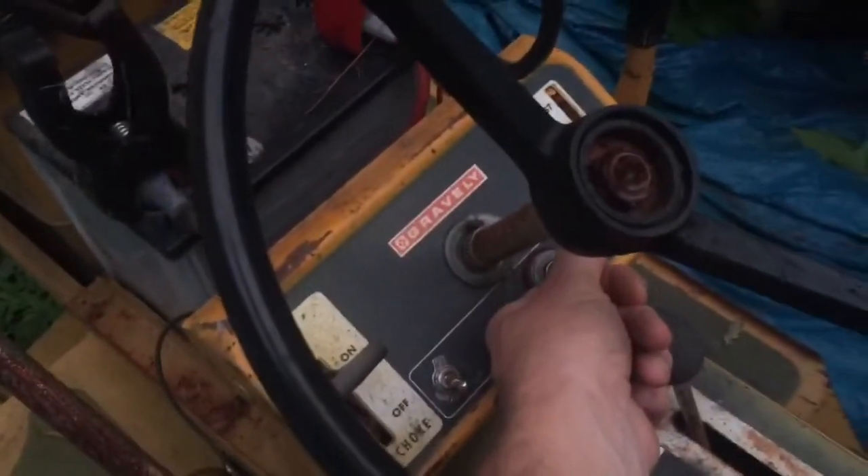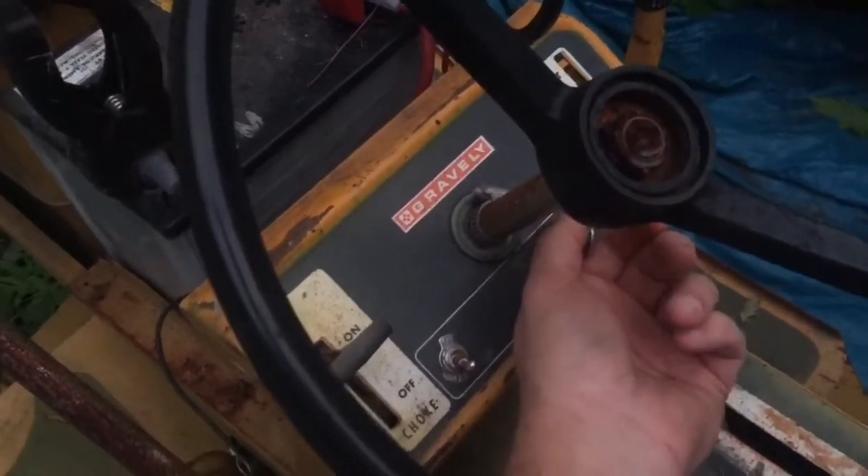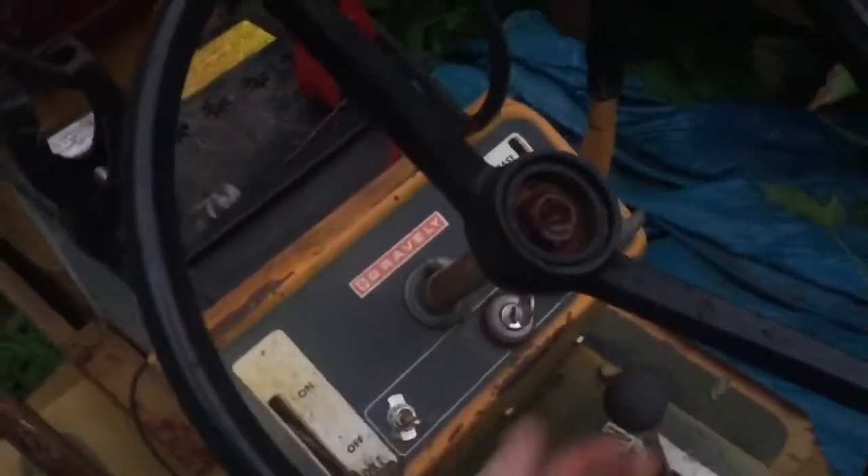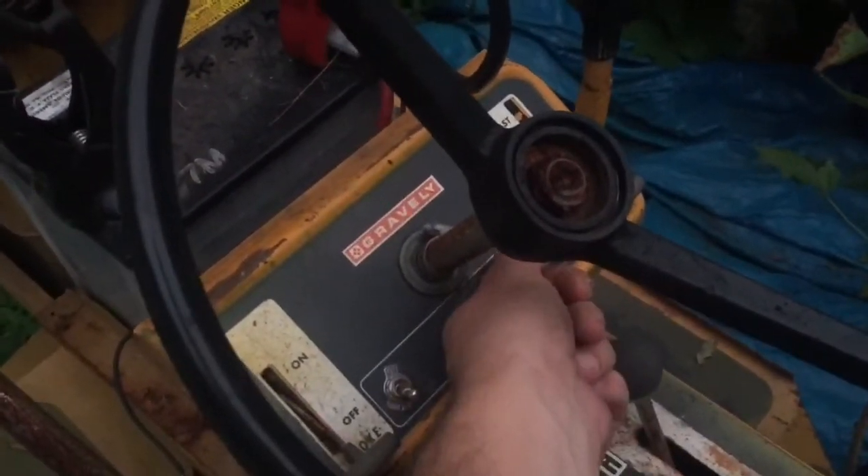There's a strawberry plant growing up over the carb here. Let me take this air filter off. Let me get my carb cleaner — a couple shots of carb cleaner in there and we'll try it again. It probably has no spark. Maybe it won't go off the carb cleaner. Probably the points need to be cleaned or something. This should have gone by now off the carb cleaner.